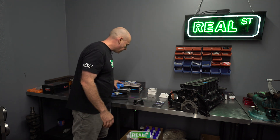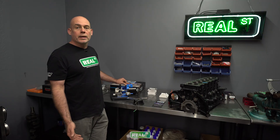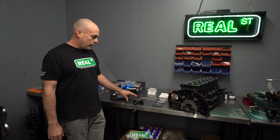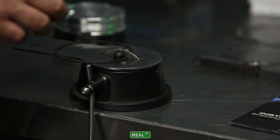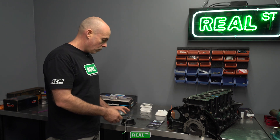If you have access to something like this — this is an electronic filer from Total Seal — it's a really nice machine and it makes this work quite a bit easier because you have a controlled file speed and a controlled feed rate, so you don't have to worry about as much human error. With a manual filer you could easily ruin a set of rings, so work slowly and carefully. This tool I've probably had for 12 or 14 years; it's not the fastest way to get the job done, but if you use it carefully you'll have a good outcome. You're going to file in one direction off of one side of the ring, being careful not to load the tool against the ring so much that it chips. You're more trying to glide the cutter over the end of the ring instead of forcefully cutting it. If you use too much force you'll damage the ring and you'll have to get another ring set.